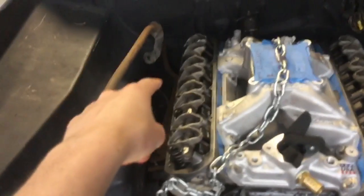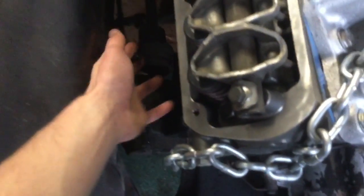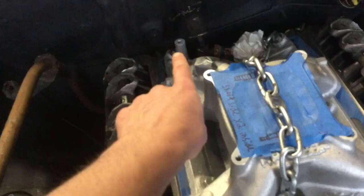I'm going to do from the fuel cell up to the fuel pump in braided line, then from the fuel pump up right back into the engine bay. I'm going to follow the same path as the factory fuel line, running up here as hard line. Then from the hard line, have it come up as braided line. I was thinking of ending the hard line somewhere right back along the firewall and having the fuel line come straight up and back here, because the piece sits like this — so hopefully it can just come out right from the back. But we'll just have to wait and see.